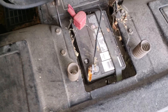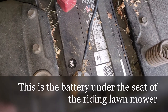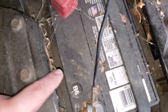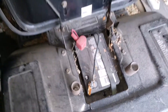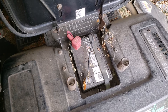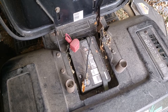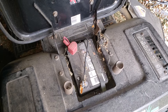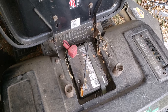The last thing I'll do is I may disconnect this battery just to make sure it's in the garage and maybe put it on a charger, that way it makes it through the winter time. This has been a pretty good battery — looks like we got this back in 2016, so it's lasted at least five years. It's kind of one of those things where you can put it on a trickle charger or you can leave it in here and hope for the best. The last two years I've just kind of left it in here and the lawnmower started up perfectly fine.